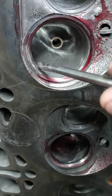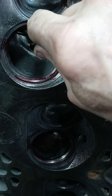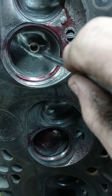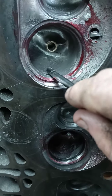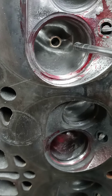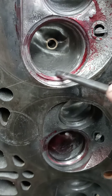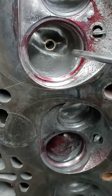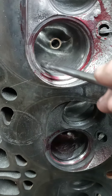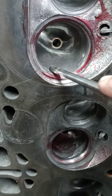I try to keep the port coming in roughly the same size. Back in the day there was a guy at did-heads who explained it pretty simply — he said you'd like the intake bowl to actually be like a flower opening up: you want it to get bigger and bigger. He never talked about percentages, but my theory was always the flatter and more consistent you can keep that area where the fuel is coming out into the air, the better.